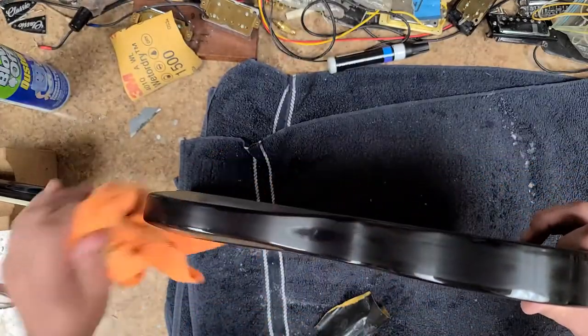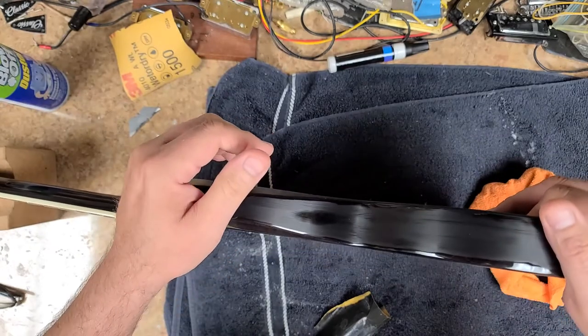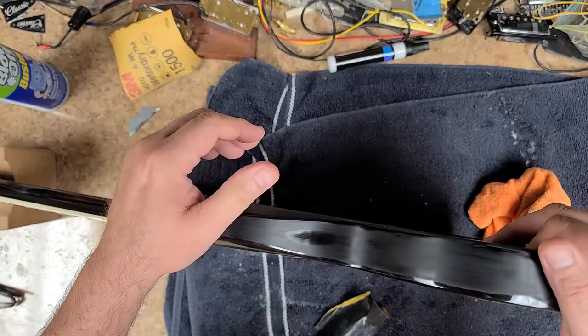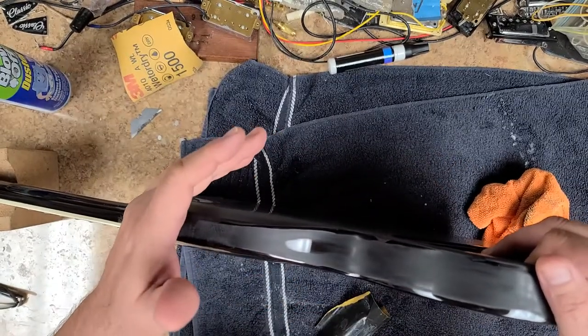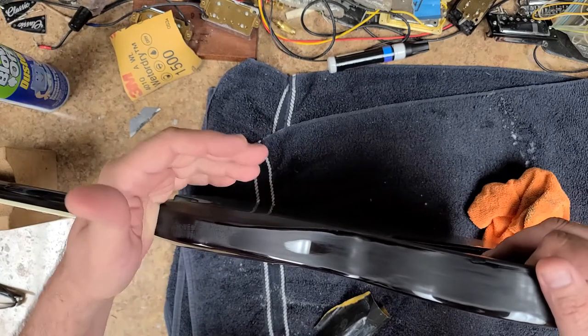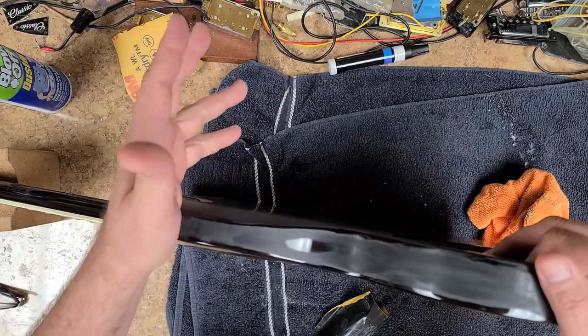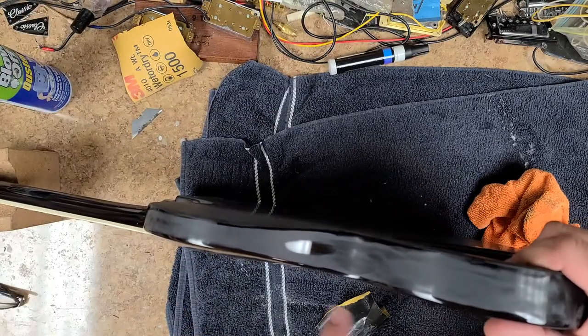Now normally on a vehicle, on sheet metal, whatever, you'll end up filling that with some scratch filler or some Bondo, and then sanding it flat again. But you don't want to put a lot of Bondo or scratch filler on a surface because that can and will crack over time. Sorry. So now this is drying better.